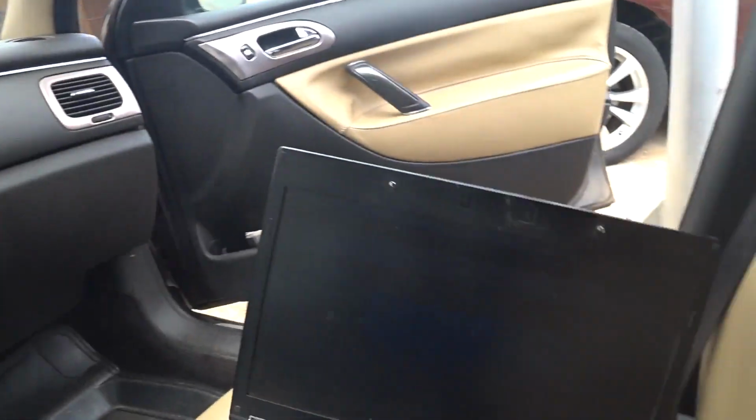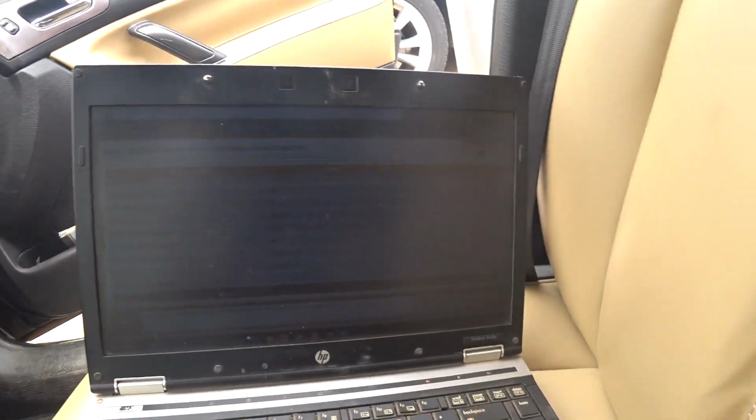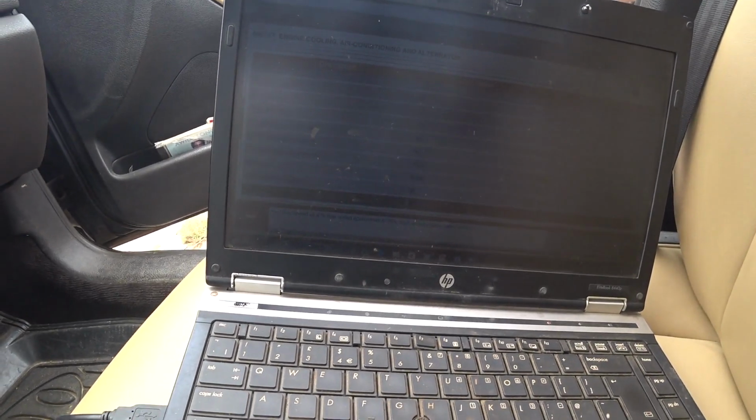Okay, so now we've learned this one too. For those who are messing up their fan wiring connection, you can see that your engine is meant to run very hot. And even the oil temperature, let me see, was actually around 120, it's even 144 degrees Celsius, the oil temperature. You can see at coolant temperature 96, 98. Okay, the fan is back on.